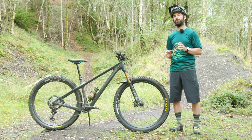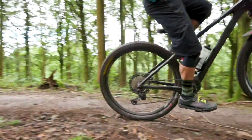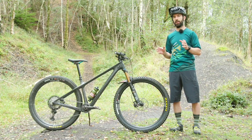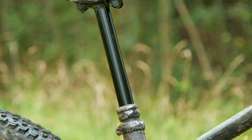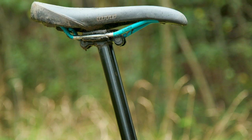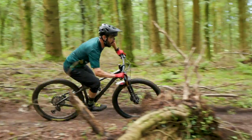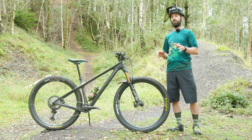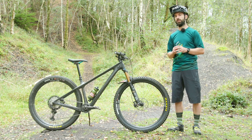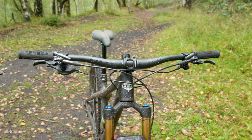In terms of geometry, it feels like Yeti have found a really good middle ground. While this bike is designed to be a trail bike and is incredibly light, it doesn't have the cross-country angles you might expect. The head angle is relatively relaxed at 67 degrees, the seat angle is extremely steep at 76 degrees for the most efficient pedaling position, and the bottom bracket sits quite low at 310mm off the ground. Reach spans from 420mm on the small up to 490mm on the extra large — this medium here is 445mm.